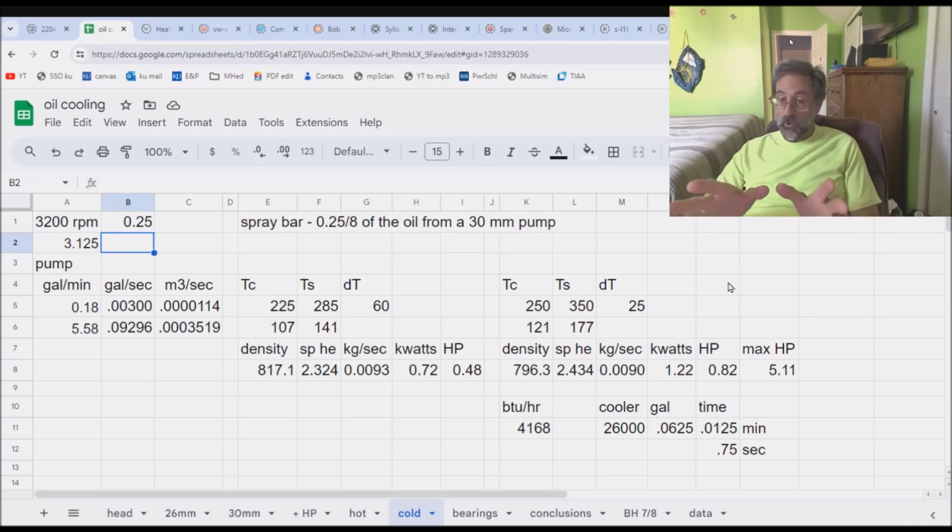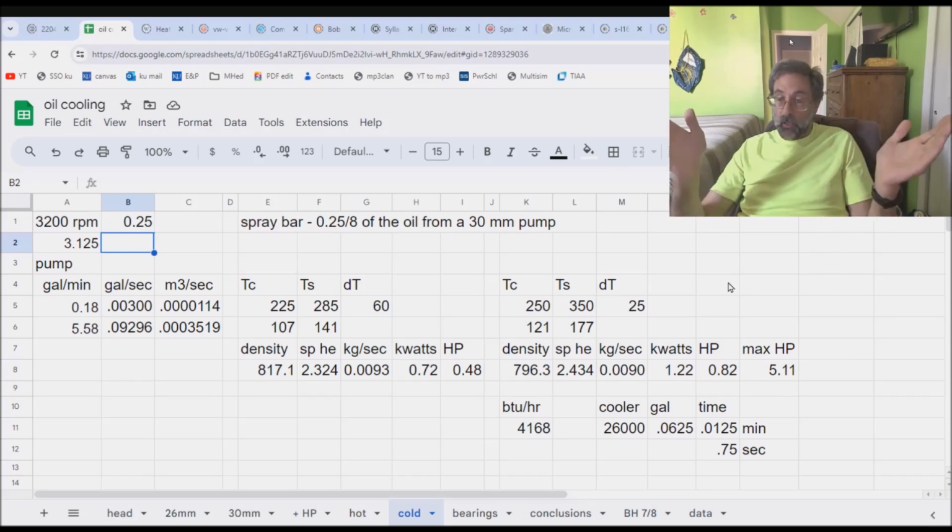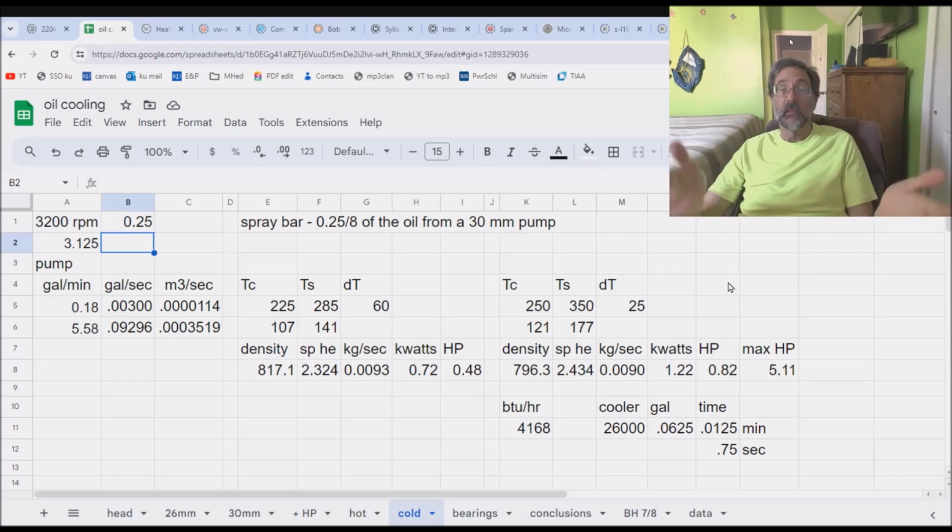Got a gigantic oil pump, but it also has a gigantic bearing right back at the prop. So they've got to feed oil into that gigantic bearing, so they gave their engine a gigantic oil pump. It's there for that gigantic bearing. And if you look at the oil cooler that those guys use, oh, whoopie, it's a 5 horsepower cooler. So yeah, the masters of sustained high horsepower output do not do anything with the oil other than pretty much stock and then feeding their gigantic oil cooled and driven bearing. Revmaster, go check it out. Maybe I'll put a link down in the descriptions.